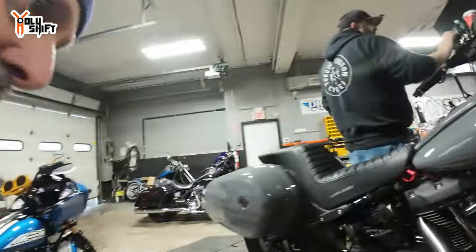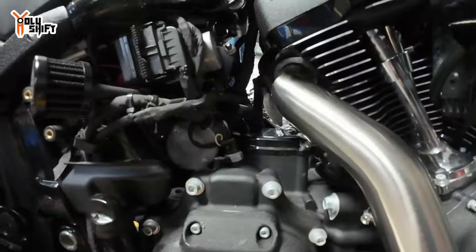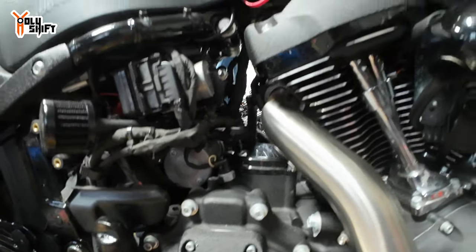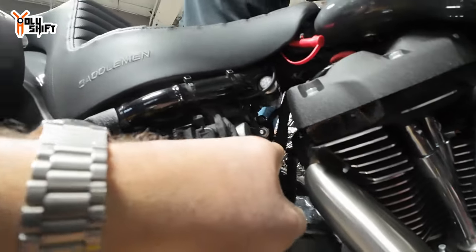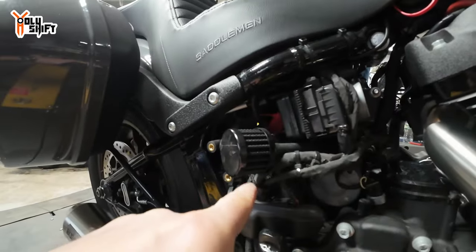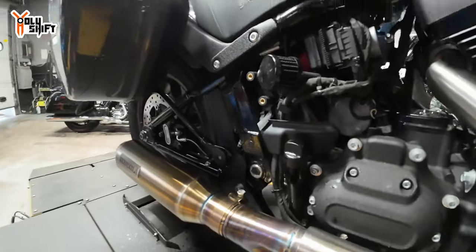So a good example of blow-by: pressure built up from blow-by in the transmission area. There was a lot of air and high pressure, and it vented out through the transmission breather cover down to here, and this is where it dripped and hit the exhaust, and that was all the smoke that we just saw. Just shows you that actually that breather does its job.